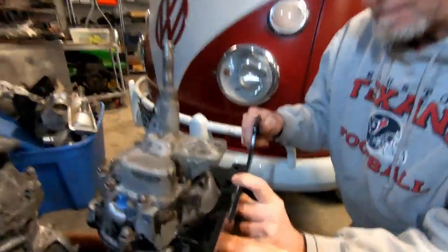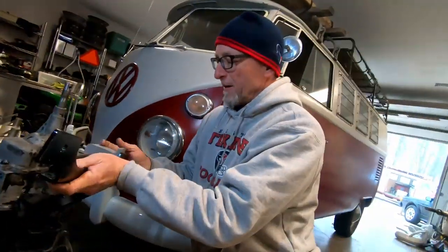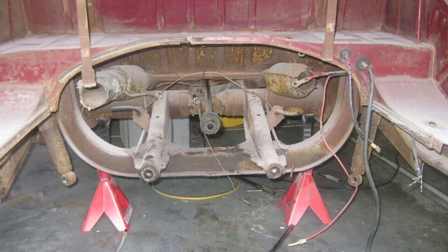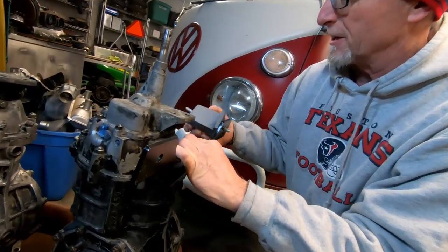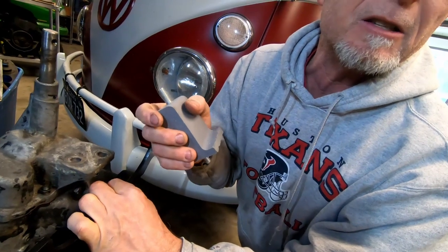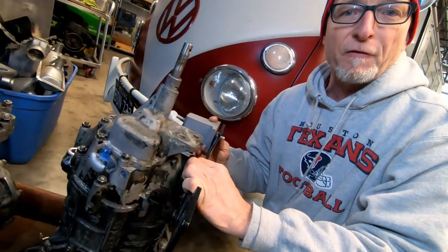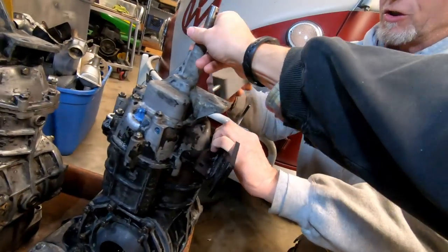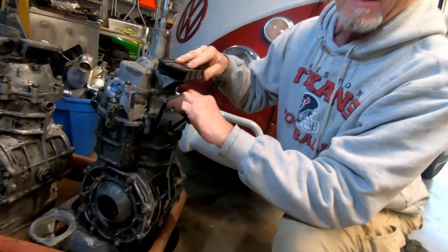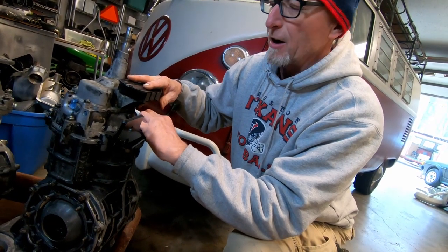So if I get this right, you put this on the gearbox and this goes on the bus, and then the two sandwich together to provide the support for all this weight that's pushing down. And then this will go in and hold in those frame horns — frame rails, transmission cradle things. This is a really nice composite — it's not a solid mount. If you put solid mounts into something, it just shakes you. What this is going to do is keep the fulcrum action from happening — all the stress on that nose cone. You don't want to break a transmission mount in a split because it's a really major issue to go back there and change those. It's a lot of work.